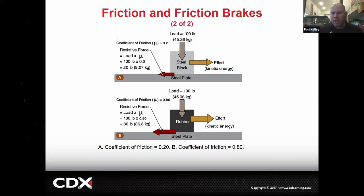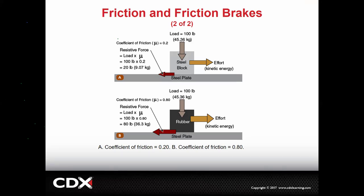This whole talk on kinetic energy going to heat energy relies on friction. And these brake pads have a specific coefficient of friction. And if I soak them in oil, they no longer have that coefficient of friction. So get your oil and get your sloppy brake pad grease. We have to lubricate some parts of the brakes, but we don't blob it all over the place. Take your oily hands and keep them off my brake pad lining. Keep them off of there.